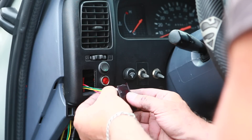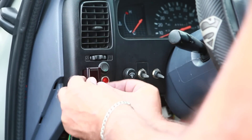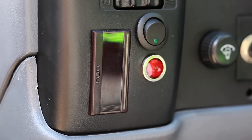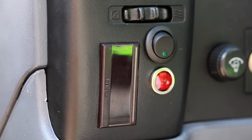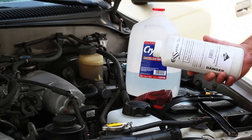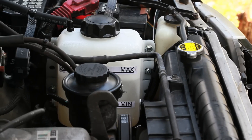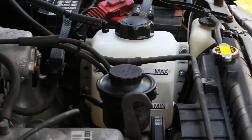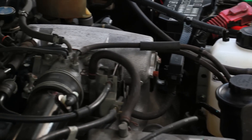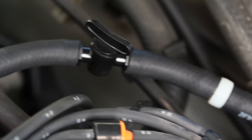Now comes the amp meter — connect and insert it into place. Make sure you put it where you can see it while driving. Pour into the tank distilled water and potassium hydroxide as electrolyte in the quantities indicated in the manual. I filled it slightly below the mark so I could add more to calibrate my concentration. Before starting, check all your connections, open the vacuum valve a bit, and check every clamp for loose connections.